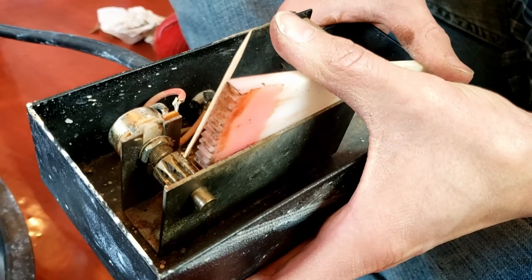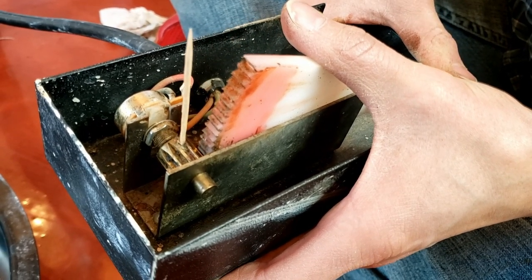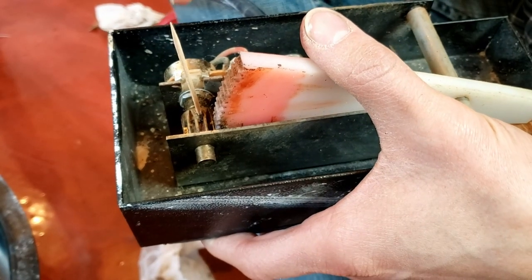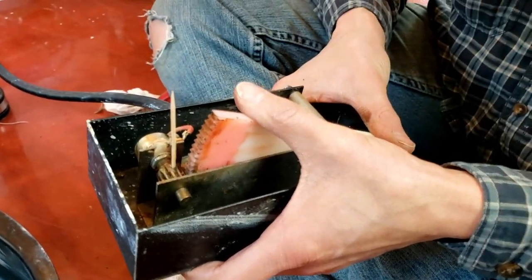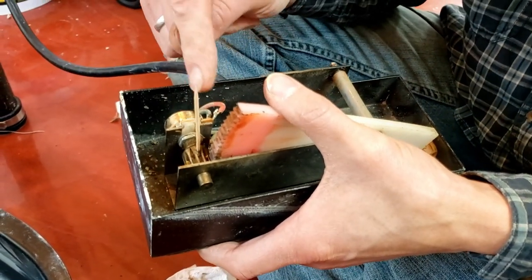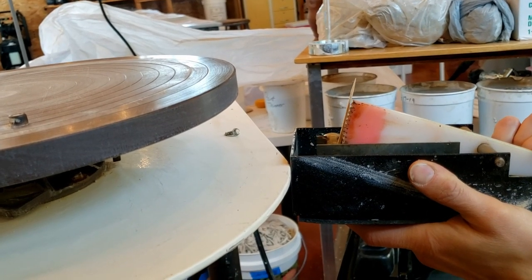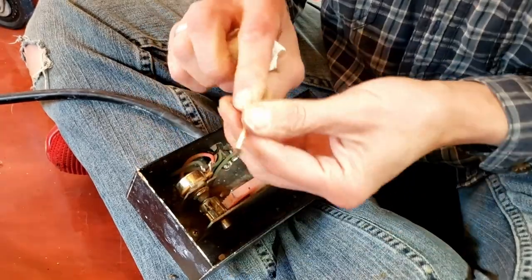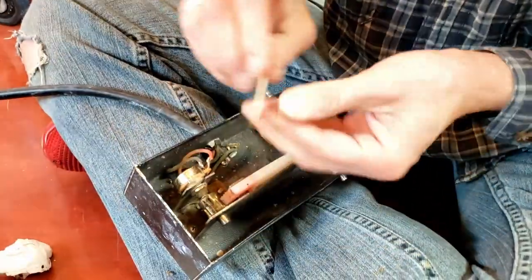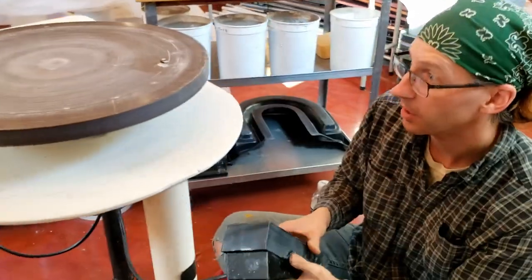So that's on, and I adjusted it so when you press it all the way down there's off, there's more off. It wasn't calibrated anymore, so it never fully shut off — that's why it mysteriously came on, because the potentiometer thought it was almost in the on position. There's off and then more off. Look at the gunk in that one — wow. So that should be it: adjusting the gear on the potentiometer was the fix for the chugging.